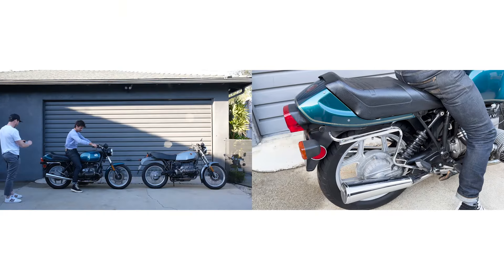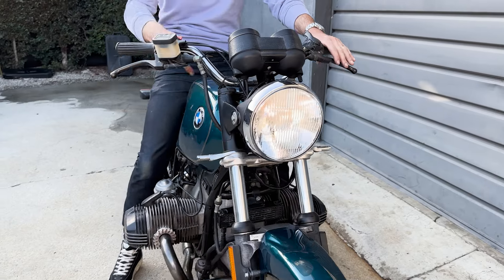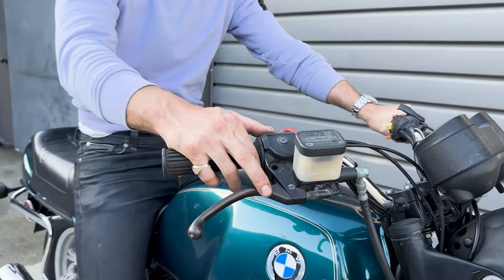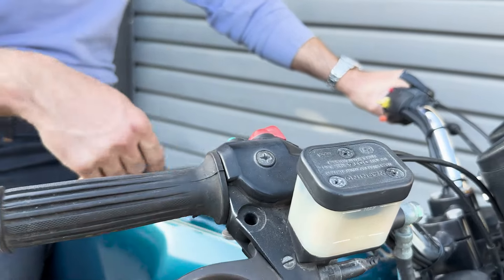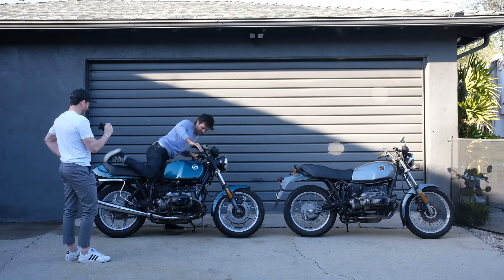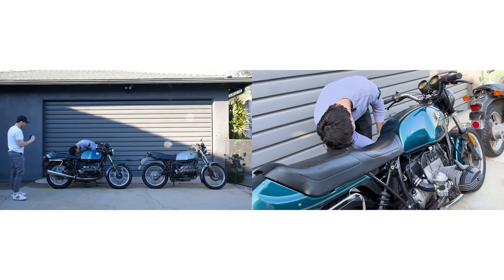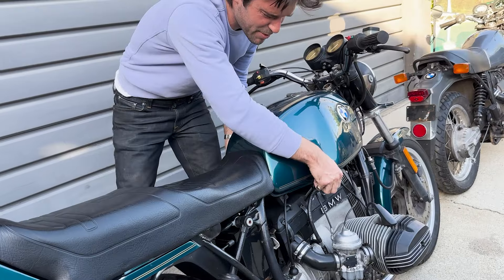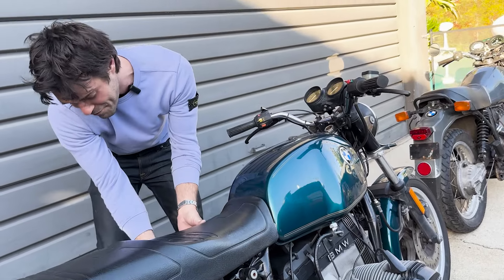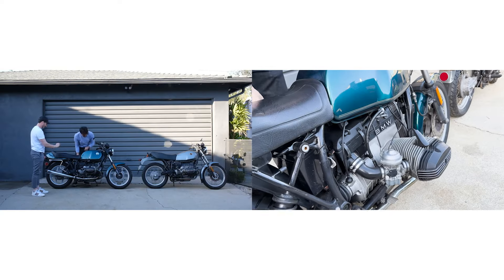Let's put the choke on. The chokes work. Is it a bad idea to stand behind the bike? Nah, it's going to smoke like crazy. Let's go — nothing. I can hear it clicking at the relay. So that's not the starter solenoid — it has no juice, because it would go. I can definitely smell petrol as well. Oh yeah, it's definitely leaking. Lovely jubbie. Oh, don't chop it up, save it!